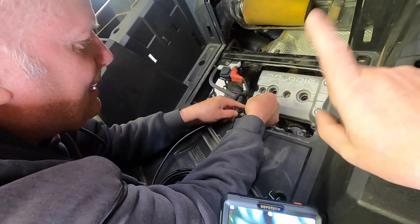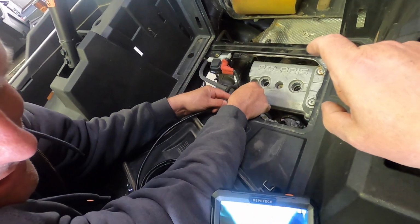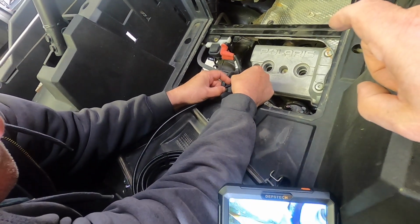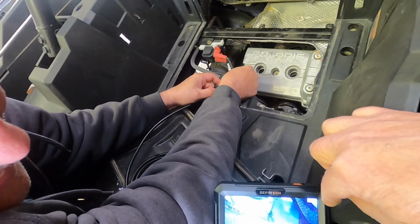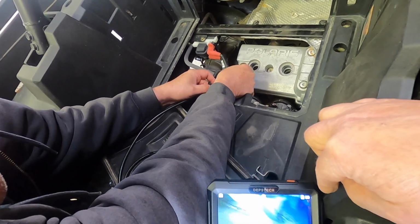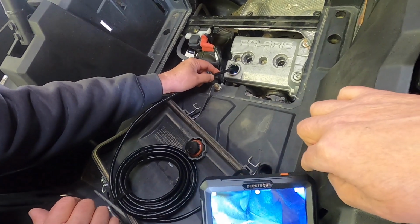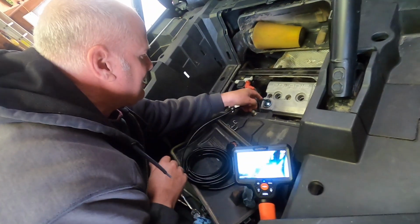Yeah. And it's more towards the exhaust. But it can't get the camshaft on the lifter. You get everything but. I don't know what, oh, that's the end of the cam again. There you go, straight down. Looks like the lobe is facing down. It might be open. That's right, we had intake valves open, right? Because there's the lobe. It's hard to get it there, isn't it? Yeah, it is. It's pretty tight in there.